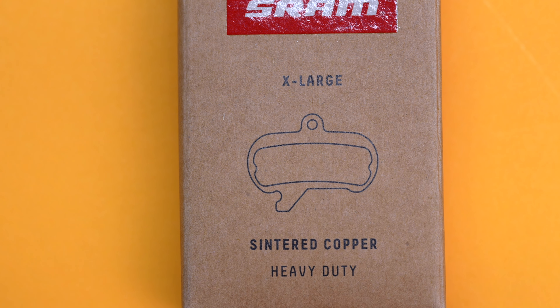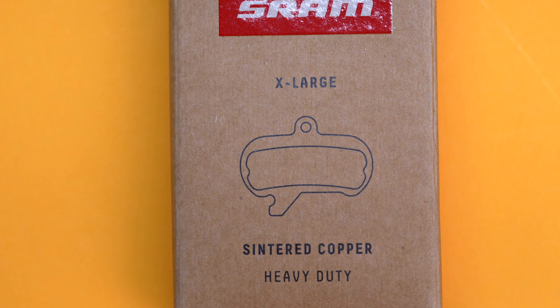You can further fine-tune your brakes by pad material. SRAM offers two XL pad compounds: organic and sintered. Organic pads have stronger initial bite and are quieter, but are best for dry terrain — perfect in Utah. Sintered pads have a little less initial bite but resist overheating better and perform much better in wet and muddy conditions. That's the breakdown on the new SRAM Maven brakes — give them a little time, and a full ride review is coming.